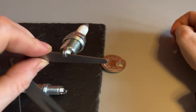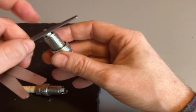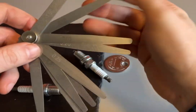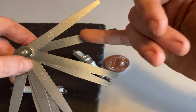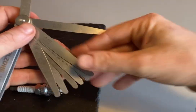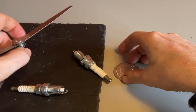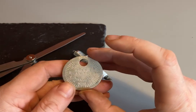That's holding fine at 1.1 millimeters. You could push this down on the table to close the gap, but I wouldn't recommend using feeler gauges for that — the steel on these is so thin that you'll end up kinking and damaging them, and then you won't be able to use them again after several attempts. So feeler gauges are a far better tool for measuring accurately.